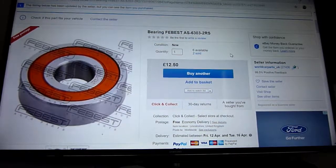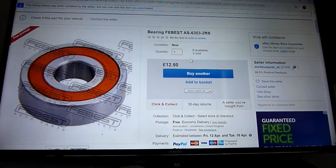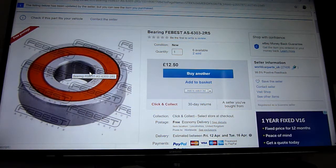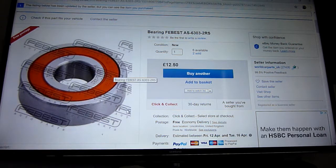Right, time to choose the bearing. I've already chosen them and bought them. The front bearing, the large bearing that's in the case. I chose this one, partly from having measured the inside diameter and the outside diameter. The inside I think I had at 17.5, but actually there's no 17.5 ones, there's a 17. I think because the rear end was worn away, it had worn half a millimetre off the bearing itself. So that was 47. The large diameter is 47.